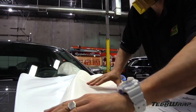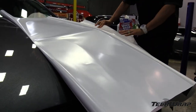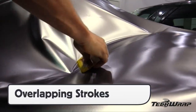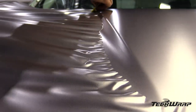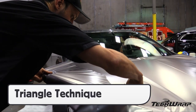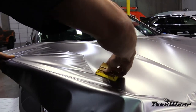Release the liner roughly 20 centimeters, then fold it back and swing the panel over the surface being applied. Once the panel is over the surface, hold it away at a 10 degree angle and then work in overlapping squeegee strokes from side to side. When approaching recessed areas, always feed them in when possible — this will help avoid over stretching. Once the backing paper is fully released, use the triangle technique to work the film flat in a steady manner. This will help neutralize the aggressiveness of the adhesive.